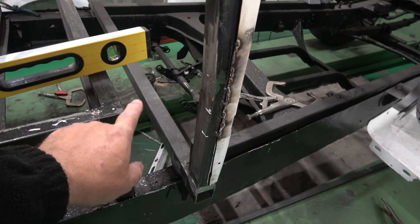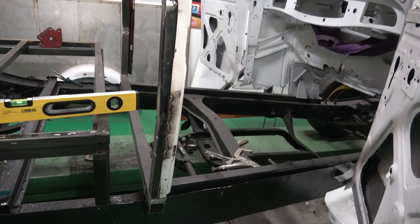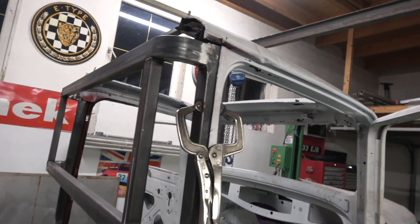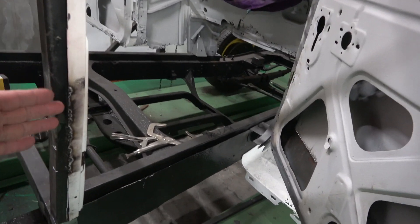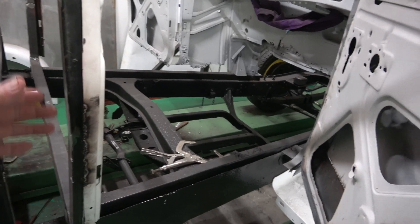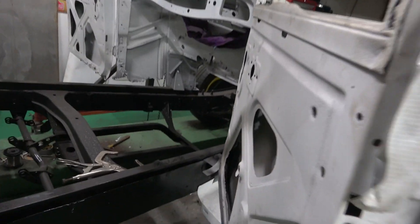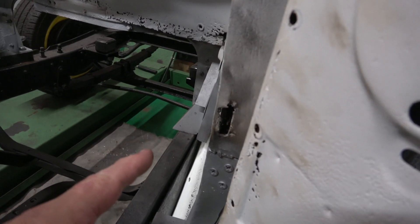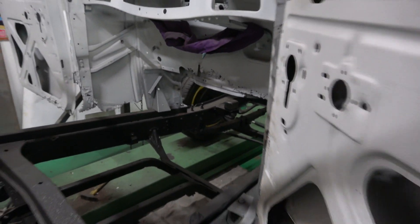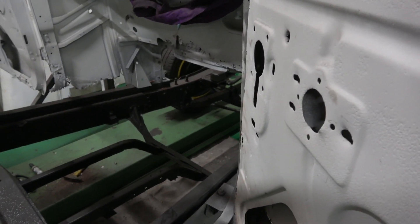Each crossbar across here — so the next one will be 35, which brings it right in line with that edge again. The cab is still not welded to it at the moment because I have to work out the top piece. Before we tack off these little tack welds on each side on the bottom, we can lift it, clean the bottom part of this B pillar, paint it, then get it welded in place at exactly the right height. Then those new feet in the corners will be welded onto the box section.